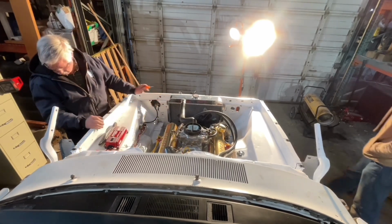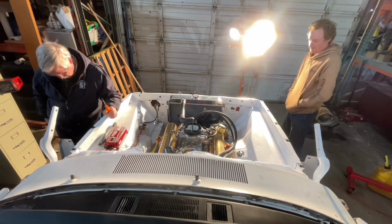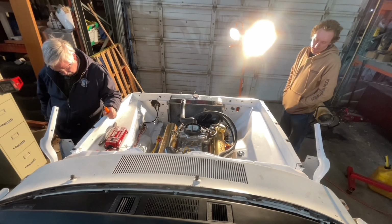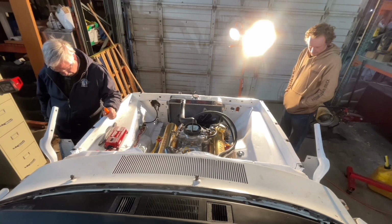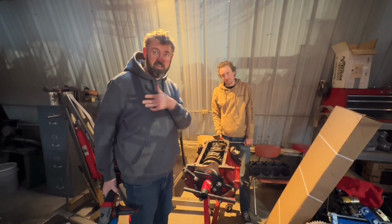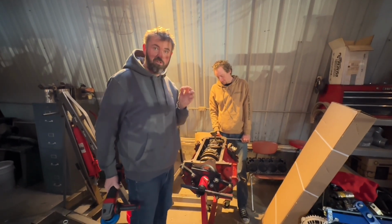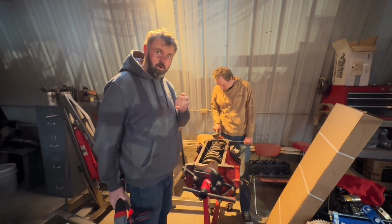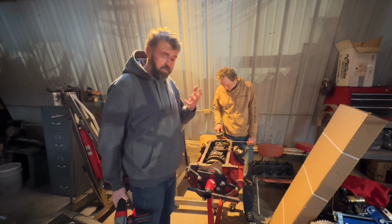So it drew sparks that time. Oh, yummy. That's delicious. But it was definitely out of right there. Out of the inspection cover. Yeah, so I'm wondering, do you want to turn it by hand one more time? So we found what the problem is on the ticking, and the bolts are too thick, so they're actually hitting the back of the block or the inspection cover.